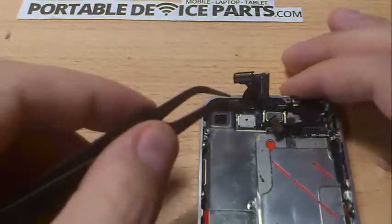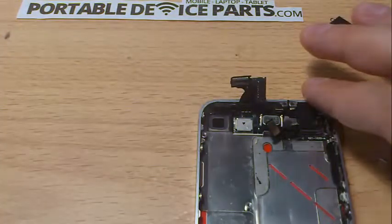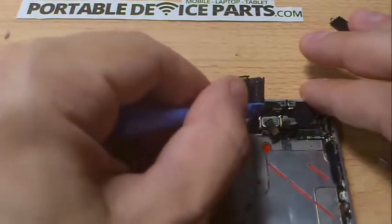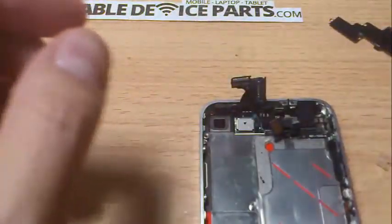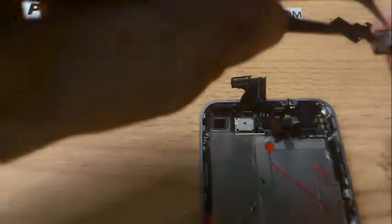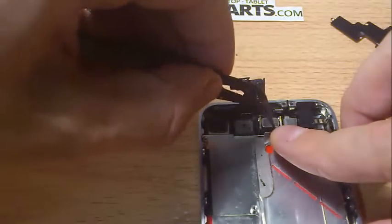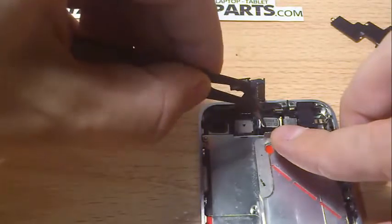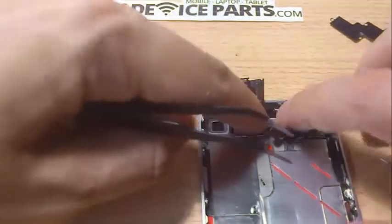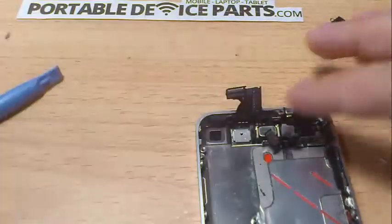It's very easy to take out, but be aware there is glue — you might have to jimmy it a bit. That one came off fairly easily — there we go, it comes up. When you put the new one down, just get tweezers and be patient. You're in no hurry. Just re-sit it like that — it might feel like it's going to move, but there's adhesive on the other side of the new one. Just push it in and you're good to go.